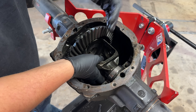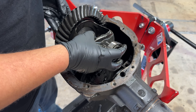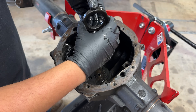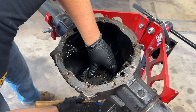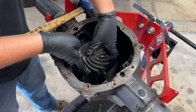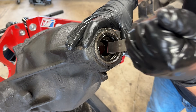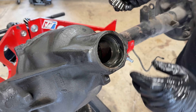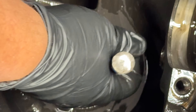We'll lift out the carrier, keeping track of the shims on either side — that way when we set up our new carrier, we'll have a good starting point. Looks like we just have solid shims on either side, though they are a different width; the wider one was on the passenger side. Now with a rubber mallet we'll get the pinion gear out — it's actually kind of comical how huge this thing is for the 2.73 gear set. With the pinion out, we can get our seal and outer pinion bearing out, then drive out the outer and inner races using a punch on the little shoulders.